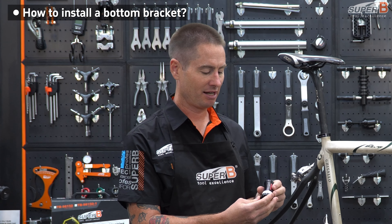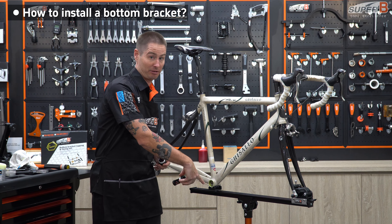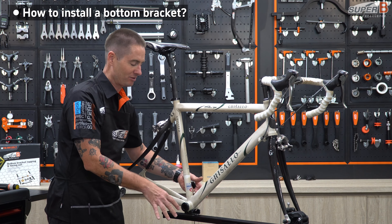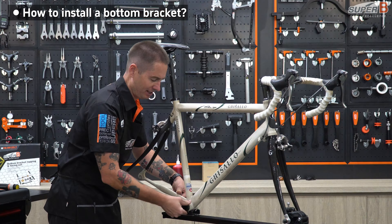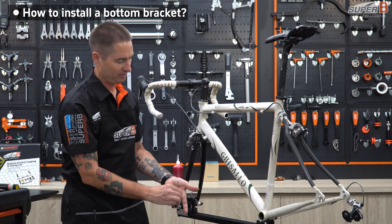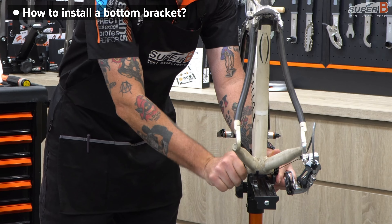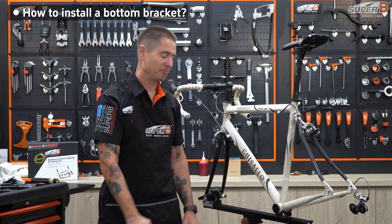First thing you want to do is locate your right-sided cup. Remember, we have left-handed threads and right-handed threads — you don't want to mix that up because if you do, you could damage this. So you've got the right-sided cup and we're going to just tighten it with your hand. It's going in nice and smoothly because the threads are in good condition, we used our grease, and we used our Teflon tape. I'm just going to screw it in most of the way by hand, not too tight. Then we have our non-drive side cup, which is going to be righty-tighty, and I'm doing this just by hand. They're nice and tight, but now it's time to get out the torque wrench and put that final bit of torque on the cups.